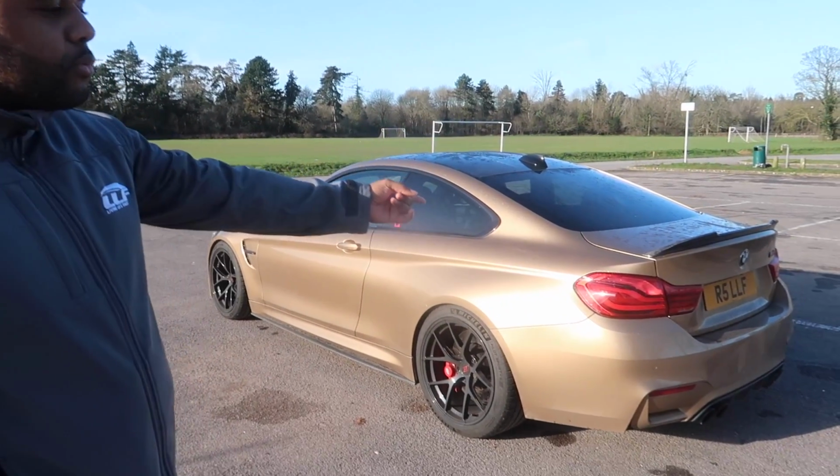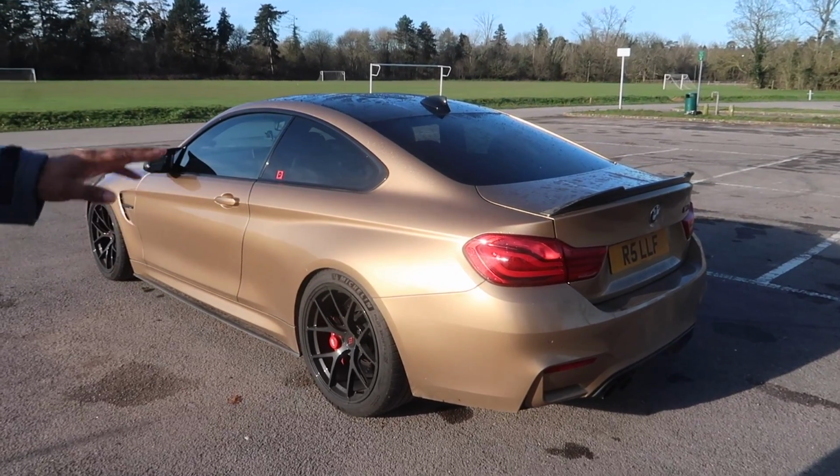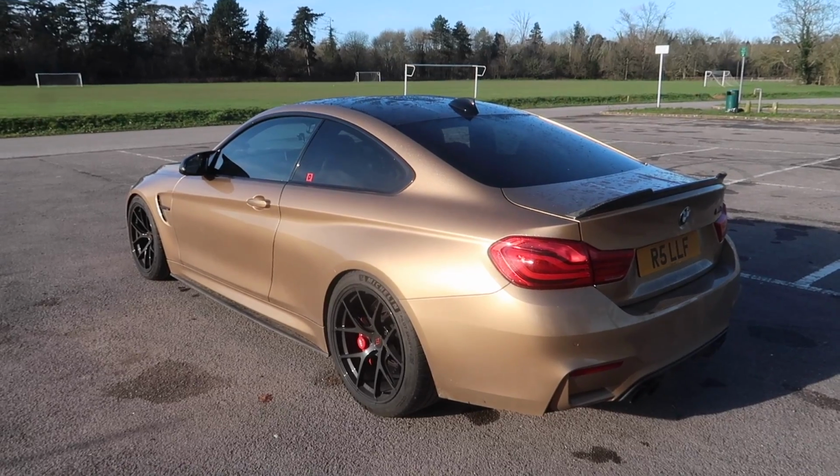And we're running methanol injection. It's a stealth tank which is hidden under where you have the spare wheel. It's got a custom flash, so it produced 658 to the wheels on a Dynojet in Belgium, and on its pump setting, which is just V-Power 99, it did 600 wheel. Recently it was dynoed at NVM, which is in Birmingham. It dynoed 667 to the crank horsepower.